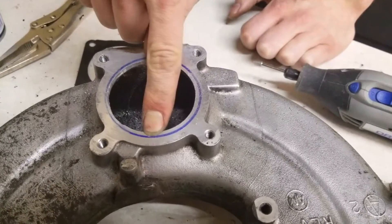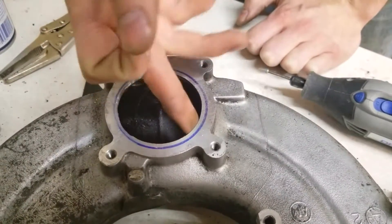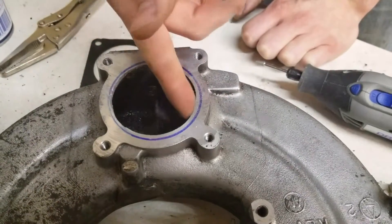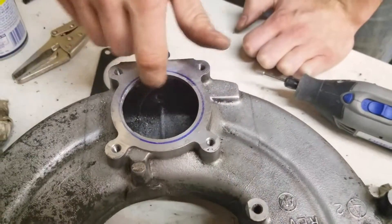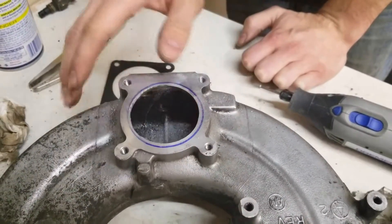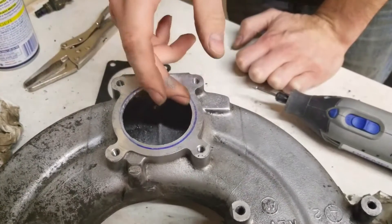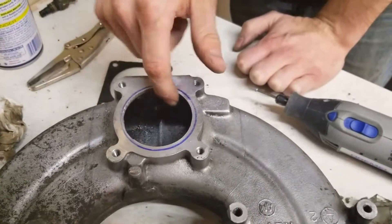Once the color has disappeared, that's when you go in and start blending the inside to continue that air flow. You're going to want to make sure you're relatively smooth on the inside, so use a stone or a polishing wheel. Just be warned that this is aluminum — stone and polishing wheels have a tendency to get gummed up because aluminum is a softer metal, so try to keep it cool.